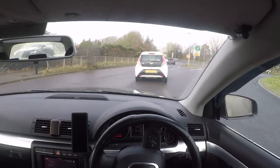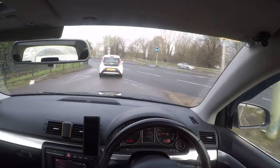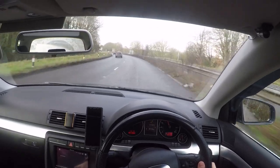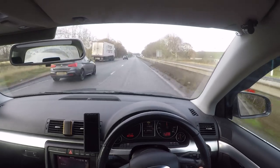So now you know how to replace a tandem pump - how does the car feel now? One of the first things I actually noticed is that the brake pedal and the clutch pedal felt a lot sharper, because the tandem pump works with the vacuum for the brake servo which kind of works with the clutch as well. There's loads of police cars all about - that's not going to look weird at all with a fat camera up. It's getting into gears a lot easier now as well. I used to struggle getting into first and second gear but now it goes in cleanly.